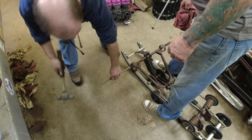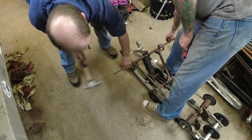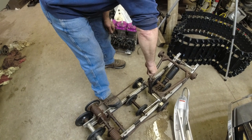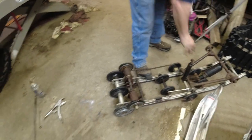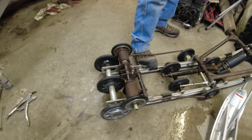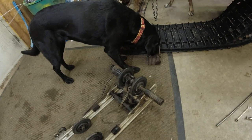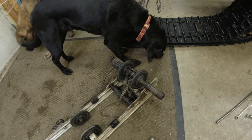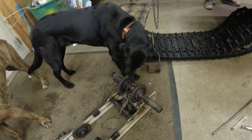Standard maintenance — we're going to knock the shafts out and grease them. Since we have the skid out, might as well get it all lubed up. Dennis' rear skid — the shock is junk. It's got very little of anything left in it; it should be about twice that hard. The shaft on the rear scissors is completely seized. So we've got a donor over here. I dug up the last remnants of an old skid with a couple springs. We're going to put it in, we're going to make it work. Farley approved.